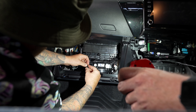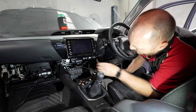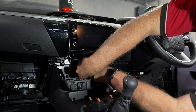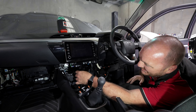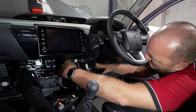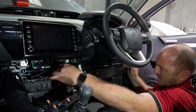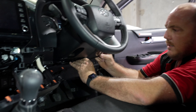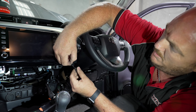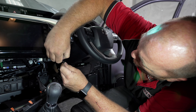You'll need another zip tie in there just to hold things in place. Once you've got that, feed the wire directly in behind the panel. You should be able to get it to your hand if it feeds well — come straight out through there. And this is where you'll add a Deutsch connector on the end of the wire. At the moment there's some electrical tape on the end. There are three colors: white, yellow, and brown.